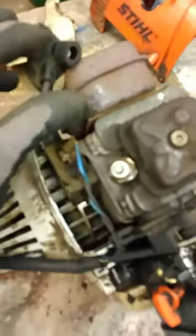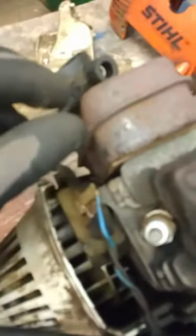And I've done that before and I've just given up and run off on it. But just put it back through. That hook will be standing down. You shove this wire back in here. There'll be enough play in there where you can shove it in there and then just squeeze it. And I use some pliers and I just squeeze it. And hopefully I squeezed it back through where the conductor is in the center of this wire. And I'll verify that with the spark plug when I take the spark plug out and clean it.